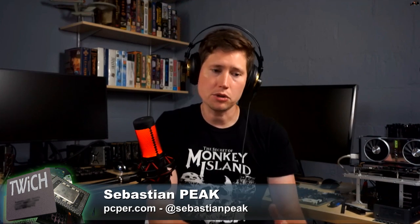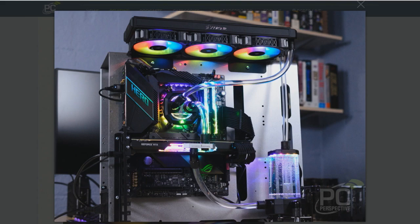They do three different levels. Level two would be like your quiet but with overclocking capabilities — they had a second radiator — and then you can go crazy with multiple radiators and push-pull fans. But with just a single 360 rad and 120mm fans, 48 degrees under load from the GPU was just nuts. It blew my mind.